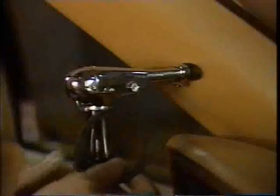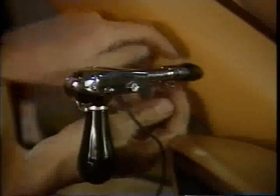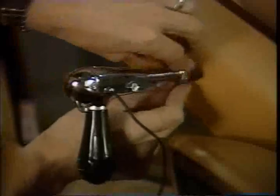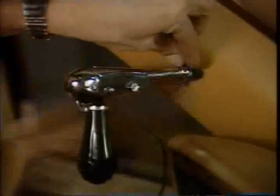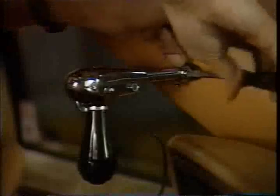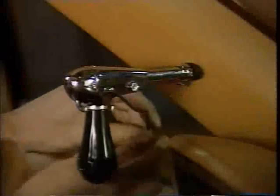The last step is to complete the electrical connection. First, stretch out the wire. Next, push the rubber bushing up against the trim. Push the clip in, and then the collar. With a small standard screwdriver, tighten the set screw. Give it a slight push, and then tighten it completely. Place the wire in the clip, and using the needle nose pliers, gently bend the clip to hold the wire, taking care not to damage the insulation on the wire.